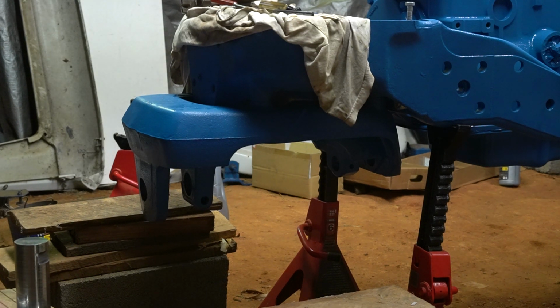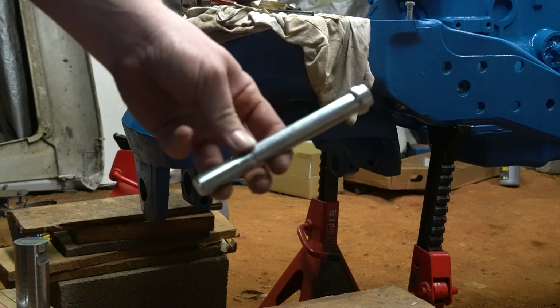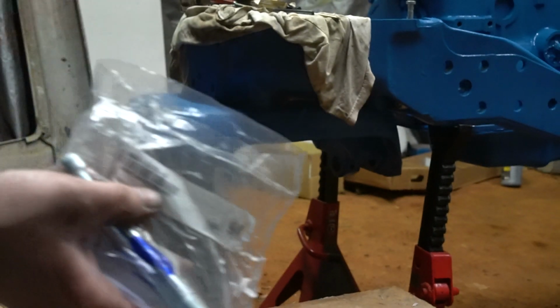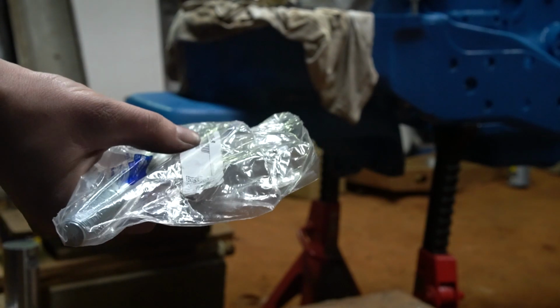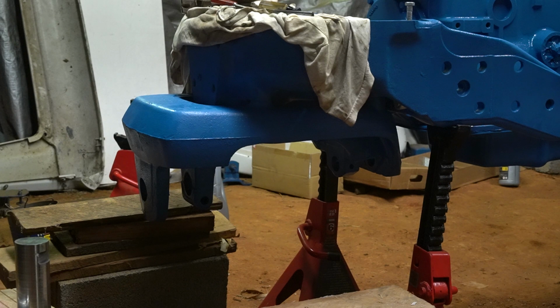Okay, and one other tidbit here. The radius rod bolts through the front axle using the same bolts as the 600 and 800. They are available, reproduced from Dennis Carpenter. The number is NAA3415B. But with all the talking done, let's start to get this thing put together.